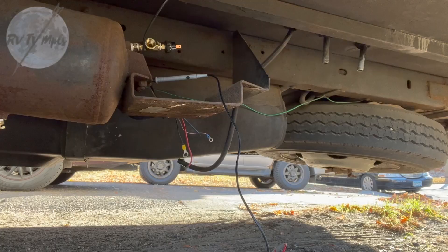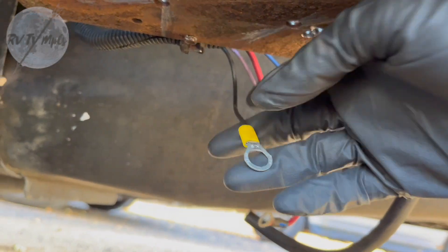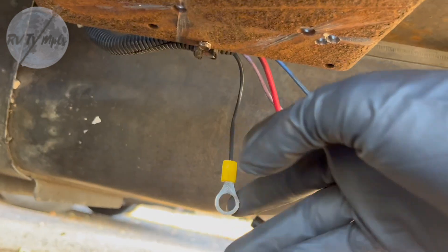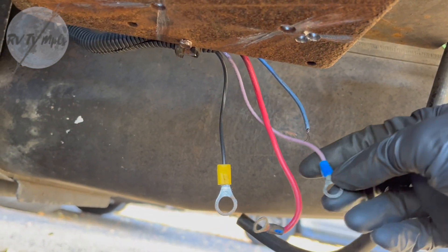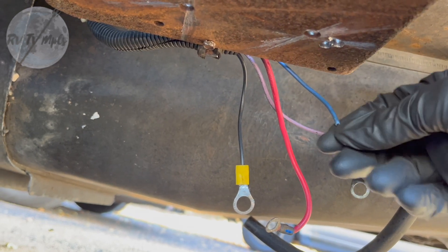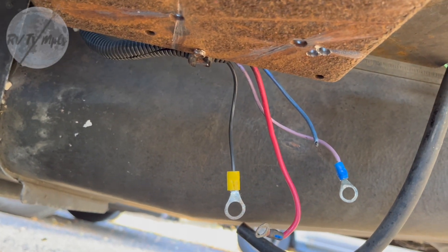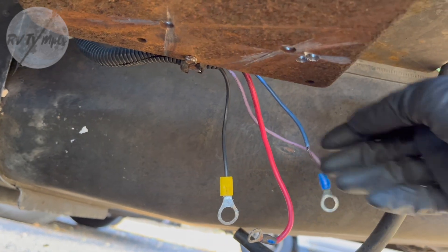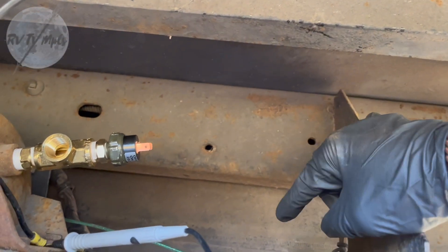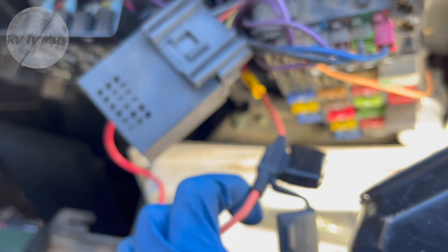Now I just got to figure out what turns on the light on the dash to let me know the air compressor is running. I have it pretty much figured out — here's my constant hot, here is power to the system itself so this should be switched keyed-on. This here is the light to let you know when the compressor is on. This is supposed to be keyed hot, but I've got no voltage here, so I'm gonna have to figure out where my key power went. If I don't have ignition power down here it's gonna be really hard to get this to work, because this and this need to be wired together to this sensor, and from this sensor it will go to the solenoid, which when it clicks on will power the air compressor to fill the tank.